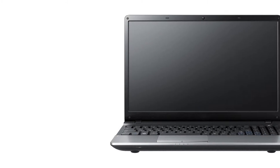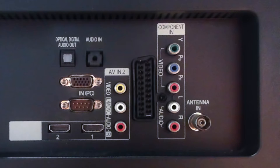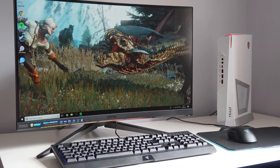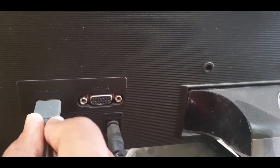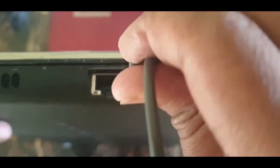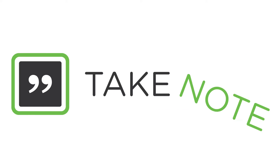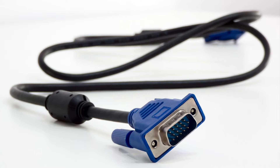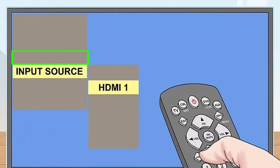Number 3: what happens if your laptop screen displays nothing and there are no sounds, but the LED indicators are fine? Before you press the power button, look for a TV with HDMI or VGA input — you can also borrow your desktop computer's monitor. Plug the cable from the TV or monitor to your laptop's VGA or HDMI output. Note: for this procedure you need an HDMI or VGA cable. When using a TV as your display instead of a desktop monitor, you must change the TV source right after the cable is plugged.